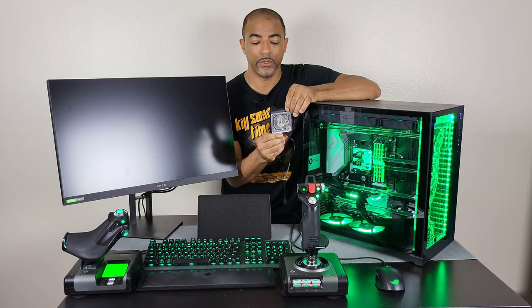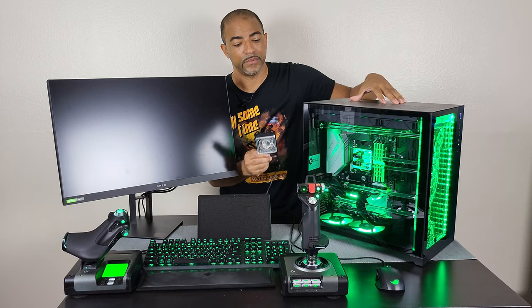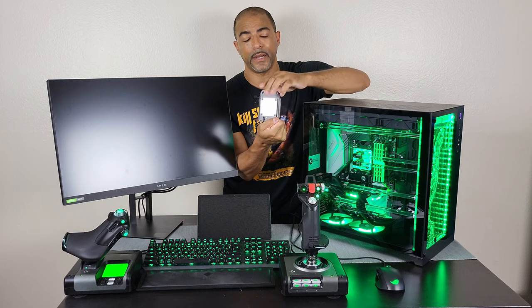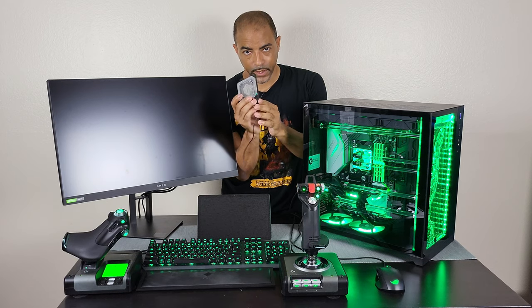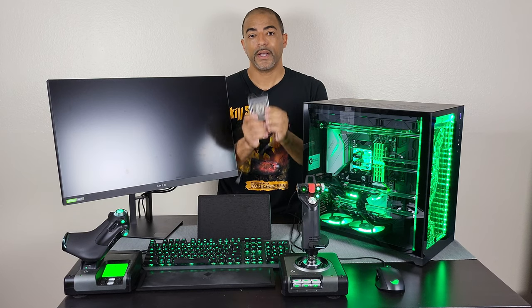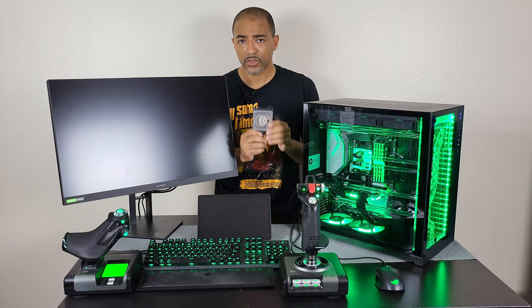Make sure you're doing your research to find out which one you need for your system. There are also metal differences — there's aluminum, and this Vanquish 295 system is aluminum-based, so its CPU water block is aluminum. This one right here is nickel-plated copper, so it's very heavy compared to the aluminum one. This copper block would pair with a copper or nickel-plated copper GPU water block. You never want to mix metals — there's a whole electrochemical reaction involved. Long story short, copper wins over aluminum. If you have both in the same loop, copper will destroy the aluminum. The aluminum will become mush and your whole loop is basically destroyed — you'd have to clean it all out and start from scratch.